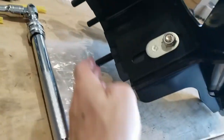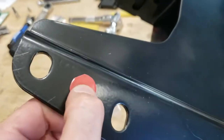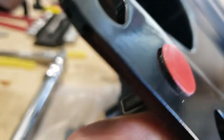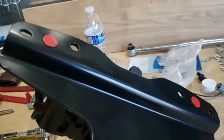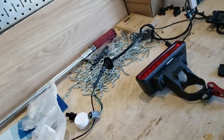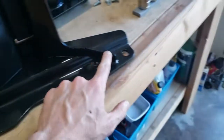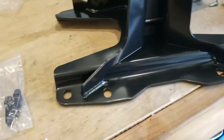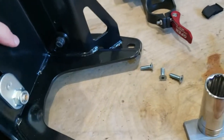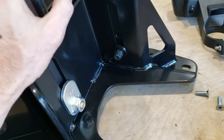The studs are fully threaded and seated down — I did break out the half inch driver with a 22 socket to get a little extra leverage. These are the middle studs. Hopefully this will be high enough to get the tire away from the backup sensor; if not I'll break these loose and put more Loctite on them later. For mounting the bracket on the Jeep, I put sticky rubber pads with a smooth surface here since this bracket appears to directly mount to the painted surface and I didn't want to put steel straight on the paint.